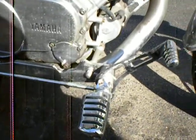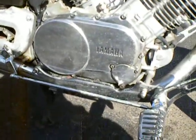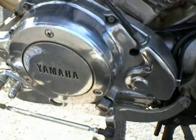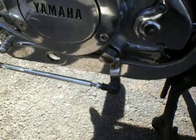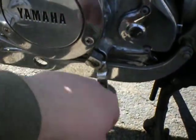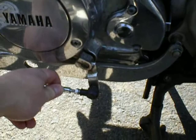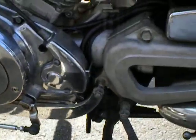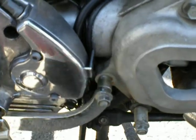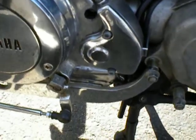Being this is a first generation Virago, I used controls made for '84 and above. They didn't exactly bolt right on — I did have to do a few things and buy an extra part. One thing I had to get, luckily from a salvage shop right around the block, is this shift linkage right here off of an '84 or later Virago — I believe this one came from an '84 1100. Without that, obviously I couldn't connect my rod for the shifter. Also, the spacing wasn't 100% — you can see I had to put some spacers in here to jut it out so this whole bar would be straight instead of going inward on an angle.